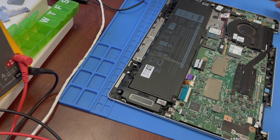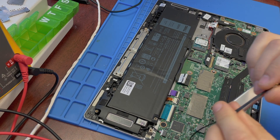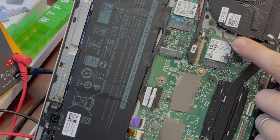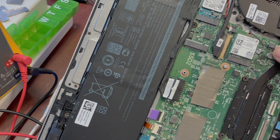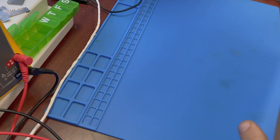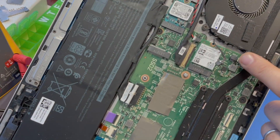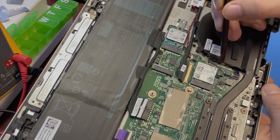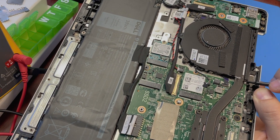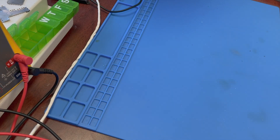Here's a little trick: you don't have to take the logic board out. These antenna cables right here have a little bit of a glue strip underneath. You just disconnect the fan and disconnect — I'm not sure what it is, probably the power button cable. Just wiggle the cable underneath a little bit right there and it comes unglued, and you can remove it from under the heat pipe. Same way you put it back when assembling the laptop.